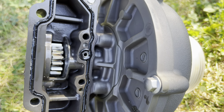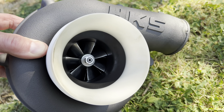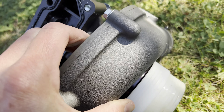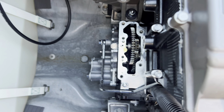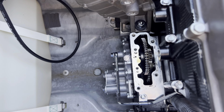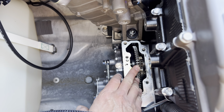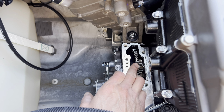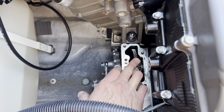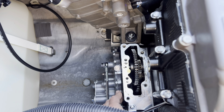So there it is. Let's see what the front looks like. We got that thing off. This is how you know your supercharger clutch is done — look, it spins both ways. So now we know for sure that supercharger clutch is done. Go ahead and start taking off the old oil pump here and I'll show you what bolts we need to take off.